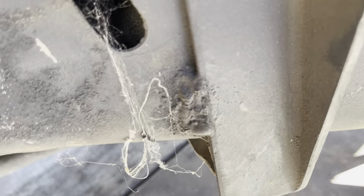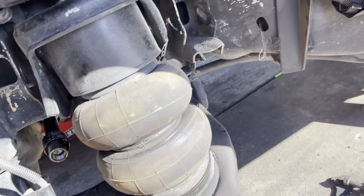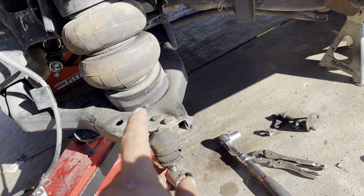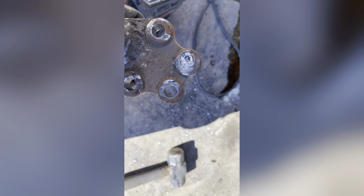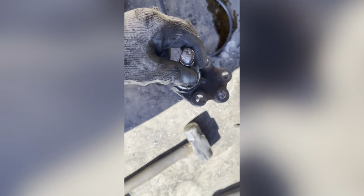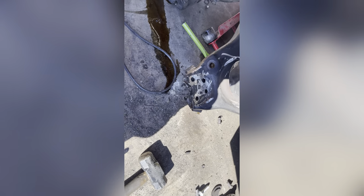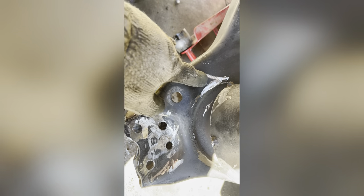God damn, look at them — that's gonna hold. This truck is one of a kind, truly. Let me get the grinder and start cutting this out. After two hours — you can hear it in my breath — that last rivet didn't want to come off but I got it. See how that's that little step? We're gonna put it backwards but with the new one. I'll need to notch this and those little tacks didn't even hold so I'm gonna have to weld this.